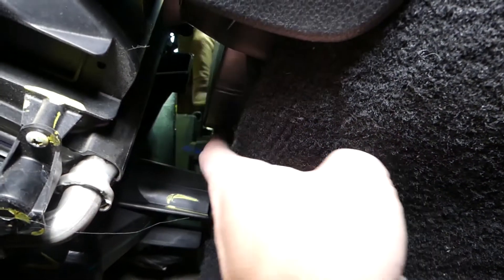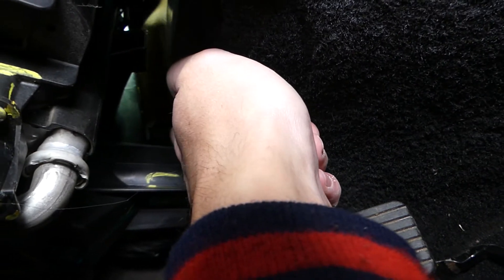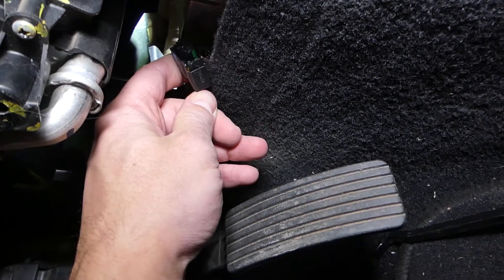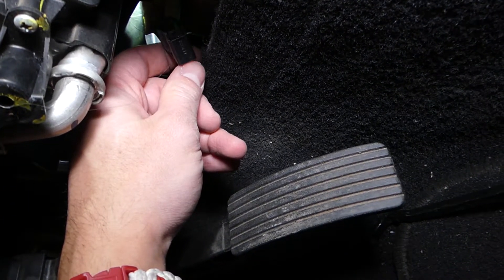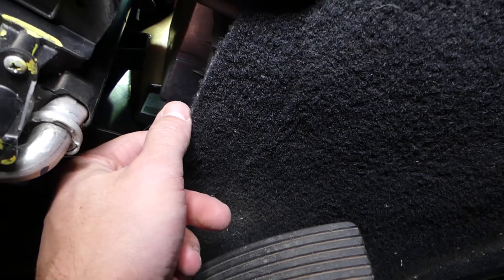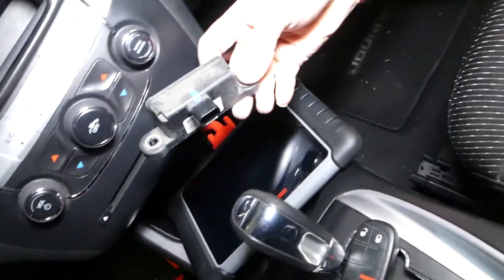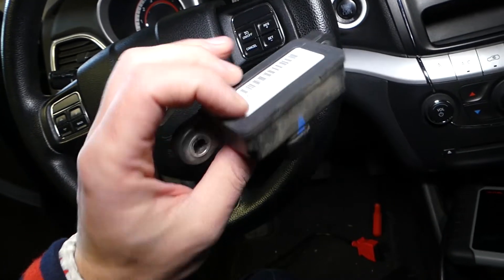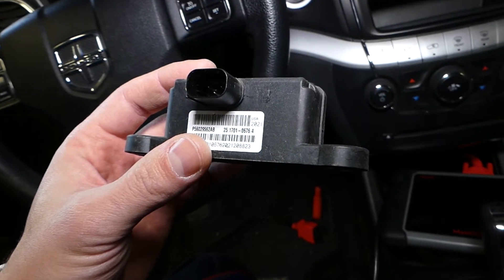Now we need to disconnect the wire — that's the only thing holding it now, that wire that we need to disconnect. This is the wire — I just disconnected it from the back side right here. Inside there are two clips: one clip with two ends that you need to push in and then pull out, and then one person is going to pull the sensor on the other side out. And this is your traction control yaw rate sensor on Dodge Journey or Fiat Fremont — just like that. That's how you remove it. Replacement is pretty much the same way we took it apart. All the parts and tools that we use will be listed in the description of the video below.